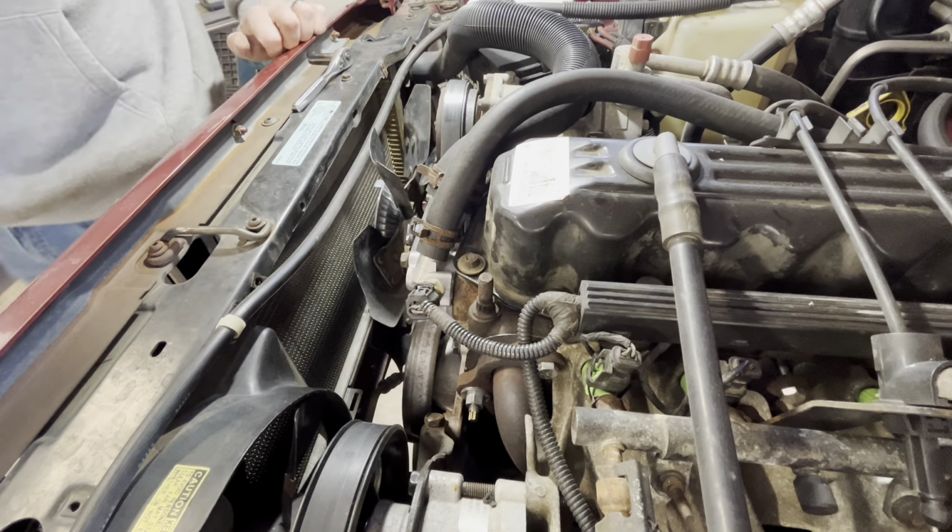All right, it's a bonus project here. Let's see, it's good. Let's see. So main voltage controls your right knob, and I believe that's fine. So obviously this is 12. Turn this off for a minute and see if, with DC motors, which is what this is, it should not matter. It'll just spin backwards if we're going wrong. This doesn't put out a lot of amperage, and these wires are relatively heavy, so it's a good chance this is going to draw more amperage than it can handle, so it might run slow.